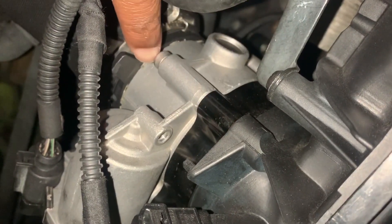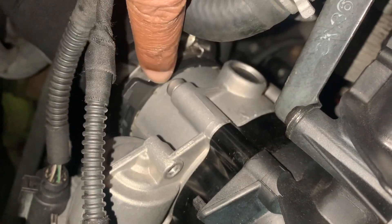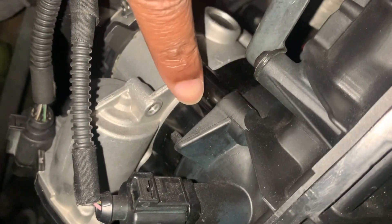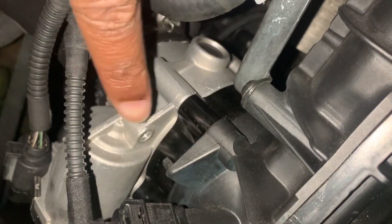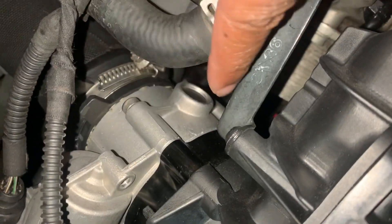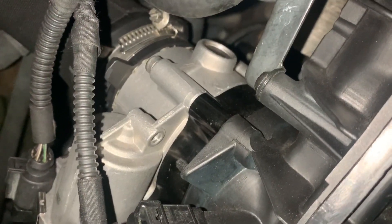The way it hooks up — it comes with extra long bolts compared to your traditional shorter bolts. What you do is take the throttle body off, make sure you put the seal in the right direction, place the throttle body spacer here, then run the bolts through the traditional throttle body, through the throttle body spacer, and into your intake manifold. Be very, very careful if you have a plastic intake manifold — you can strip it. Even on a regular throttle body job, don't go crazy with tightening. Just take your time and you should be fine.